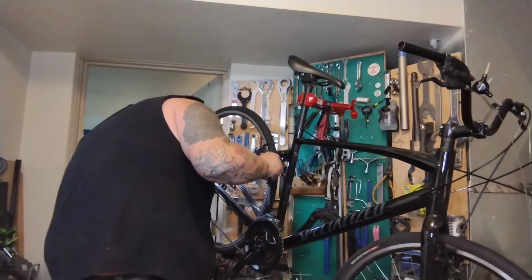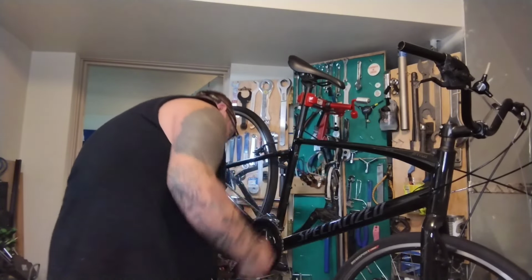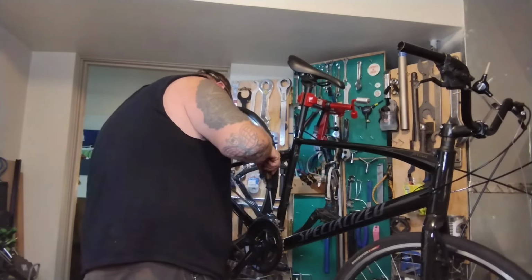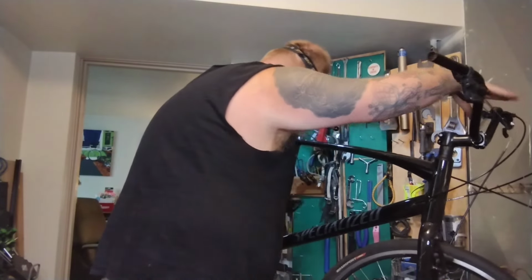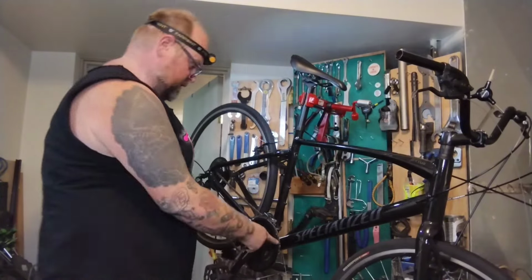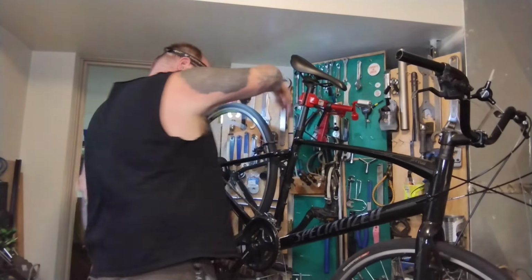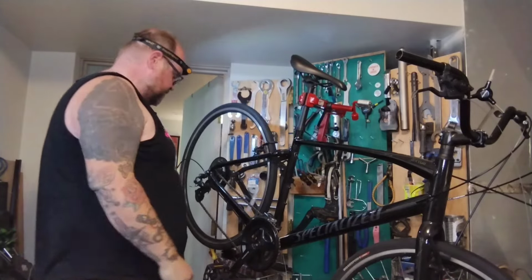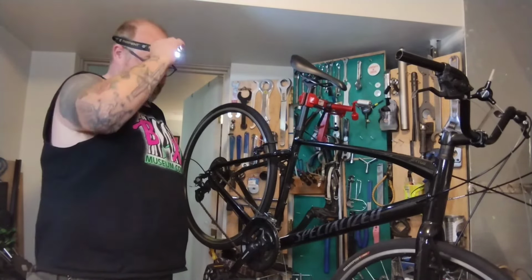just let the derailleur out and see. And they're not labeled. Oh, high-low. Good. Hey, alright. I don't think it's possible for it to overshift this big plastic bash guard. So letting it out a little bit is going to be fine, and now it doesn't grind. Front derailleur is usually the worst. In this case it was.